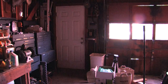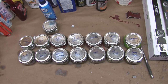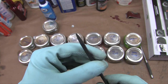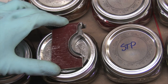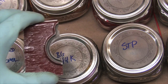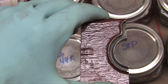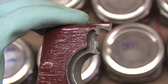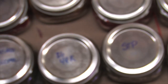It's the next day. Time to safety up and get back into sample testing — gloves, mask, and glasses. I'm using an electronics tool called a spudger because it's rigid and made of nylon, and I'm going to scratch each sample to see how it compares to a control. On the control sample, pressing fairly hard produces only a slight hint of a scratch — nothing scraped off. The purpose of this test is to see if any coating scratches away due to being saturated or softened by the soaking chemicals.